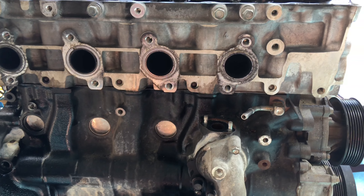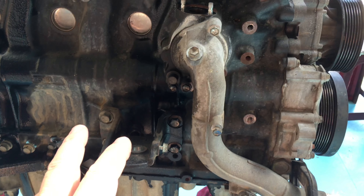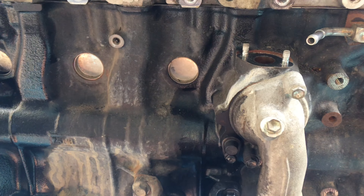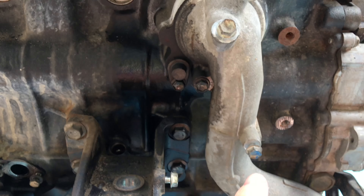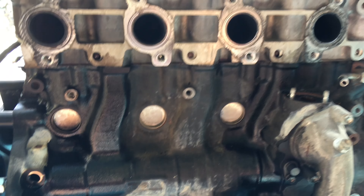Back over to the old engine. As we said, the exhaust manifold is off, the turbo is off. We just remove the heater bypass pipe which will be able to get swapped onto the other engine. Next thing will be the thermostat and the thermostat housing cover here, the engine mount and bracket this side. Then it's just getting exhaust and the turbo back on.